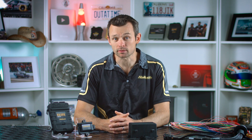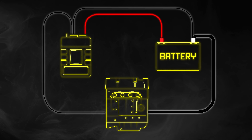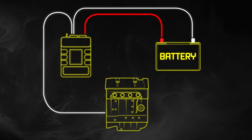Whatever people's reasoning, let's take a look at the problems this can cause. During cranking, a lot of current flows through the ground strap between the engine and the battery, so there's a voltage drop between them. When you've got multiple ground wires connecting between the same two points, the current is shared between two alternate ground paths — in other words, the ECU wiring shares some of that starter motor current. Exactly how much depends on the relative resistances between the ECU ground strap and the chassis ground strap. If you've got a good ground strap between engine and chassis, not a lot goes through the ECU. But if you've forgotten to tighten that bolt, painted the block underneath, or it's just not making good contact, a lot of that starter motor current gets carried by the ECU wires. That can let the smoke out.